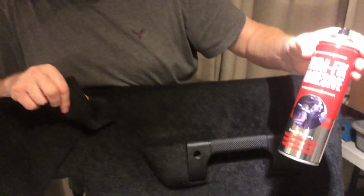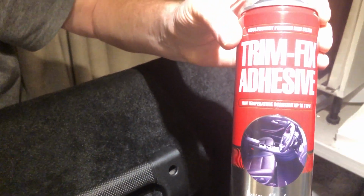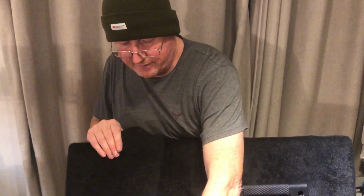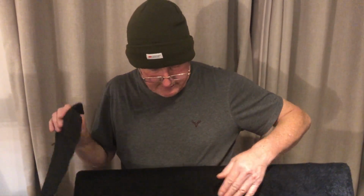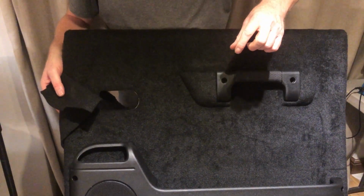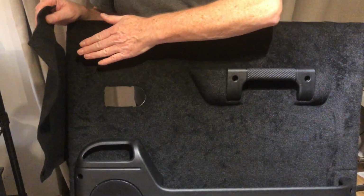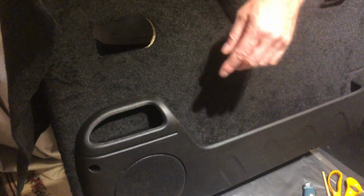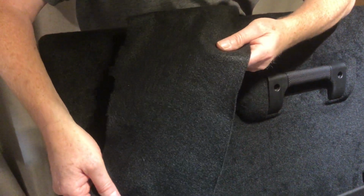Now the company we bought from supplied the four-way stretch carpet and the adhesive, which was convenient. We'll put a link in the description to them as well. When you spray across, you want to overlap by an inch or so, then spray down, and you want to do that to both the panel or surface you're doing it to, even if it was on top of a table, and then the back of the four-way stretch carpet.